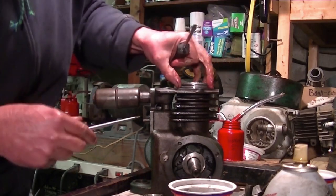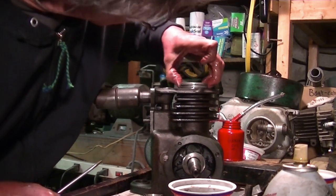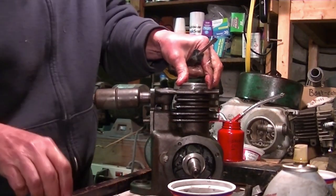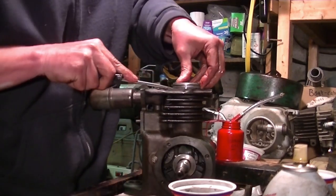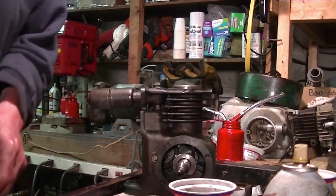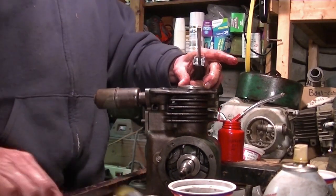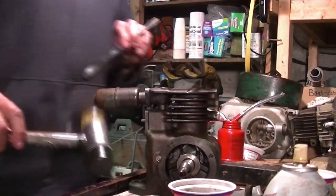Greasy chin. Okay. Oh, another thing, these rings should be kind of staggered off from each other so that they're not all in a line. They will move around, I'm pretty sure, over time. Let's see if that's good enough. No. Let's get this guy a little more. I think I got that one. Yeah, there's two. Kind of weird how these go in. Okay. Let's see if we can get three. I think this one's going to go right in. Using my gut. There it is, baby. That's in.